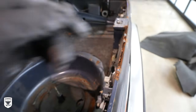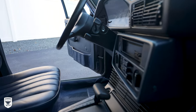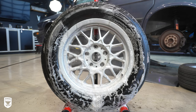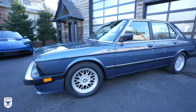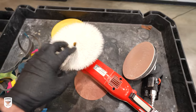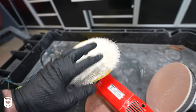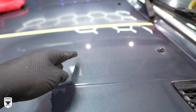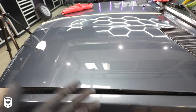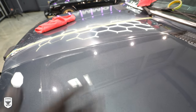You can see there's still some rust and work to do, but the interior is actually pretty badass — really clean on the inside now that we finished everything up. The wheels are sick — they're probably the most valuable part of the car, and the hubcaps look really good too. Anyway, if you guys have any questions from a studio perspective, shoot me an email or just reach out. You can definitely sand the paint and have it look great. The takeaway: a wool pad, a special wool foam pad, and one polish — not a compound, a polish — you can get this result. That's insane — you'd only be able to do that with 50 steps years ago with a rotary. Hope this is helpful behind the scenes, guys. Talk to you soon!